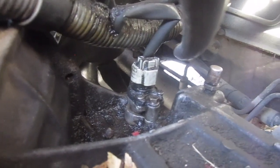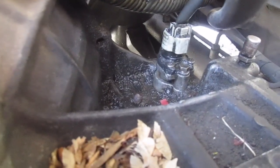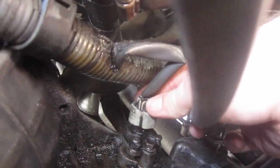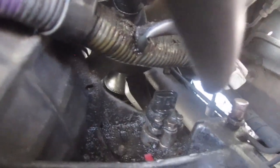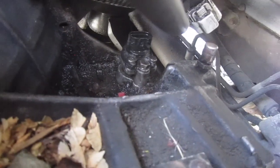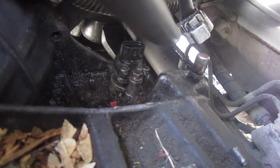At this point what we need to get to — down here you'll see that gray connector. I've already tried taking the speed sensor out twice by now so that's why it's pretty clean. I do have an oil leak on my backside so you can see the dirt that's there. The connector itself — push in on this tab and then pull up on the connector so it'll come off. I want to say it's a 10 millimeter but I have to use a small socket, so I'll show you how to take it out next.